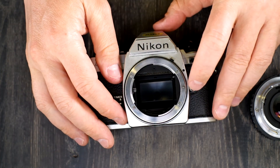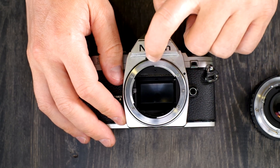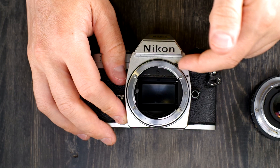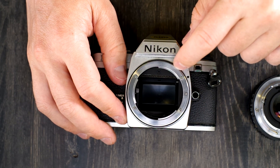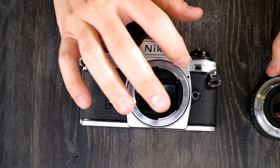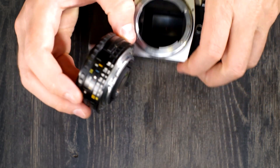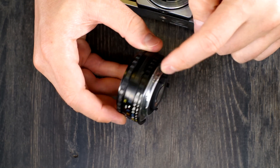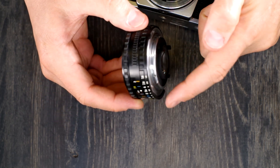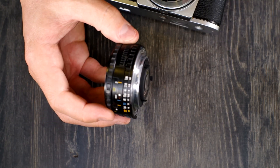This is the lens mount here, and this is the lens release button right here. This is your metering index coupler — it connects to the lens to allow the camera to know the meter reading. Because this is fixed, if you have non-AI or pre-AI lenses — older Nikon lenses that don't automatically index — they will not mount on this camera without damaging it. You can tell AI lenses because this lens has a notch cut out here and a notch cut out here. On the older lenses that cannot mount, the whole bottom is smooth. So if you have raised areas on your lens mount, this camera can use them; if the bottom is smooth, it cannot.